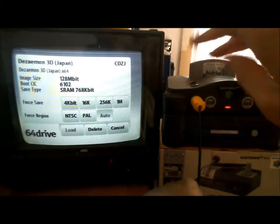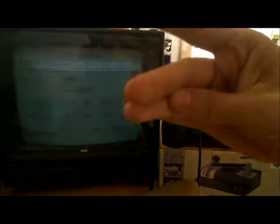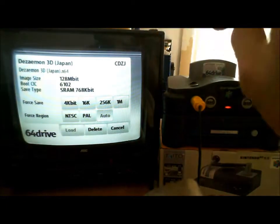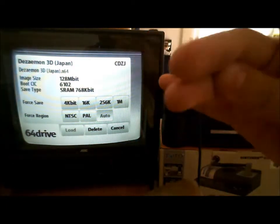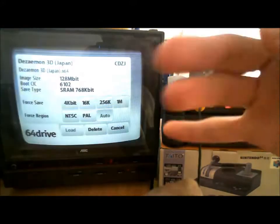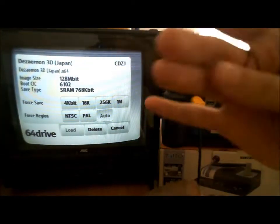I'm going to show off a bit of software for the 64 Drive that allows you to write disks onto the little disk in a dev unit. The old method was to use a Partner 64 and a card that fits in your PC and a cable and the LeoWrite tool to read and write to it. This one doesn't do that. What it does is it runs a series of instructions that writes or potentially reads data off of the drive, and in particular it can write back the ones that you dump using the 64 Drive.